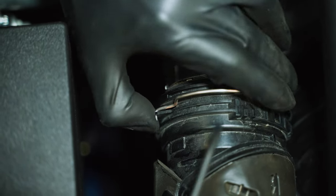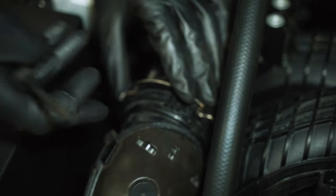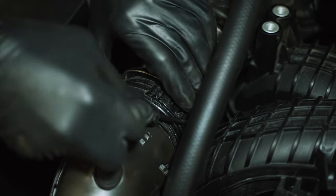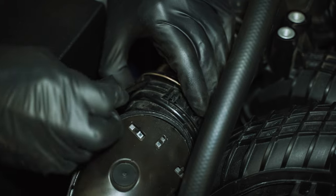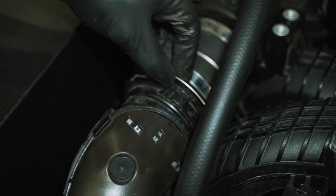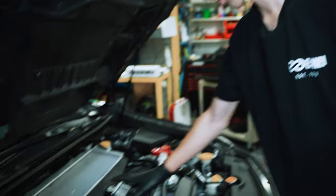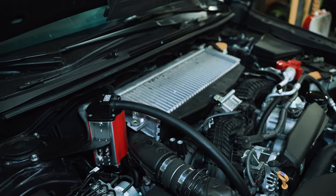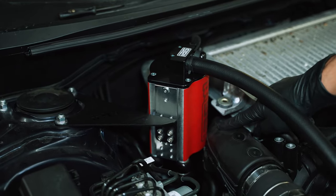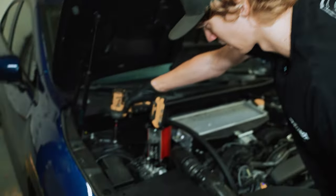You just kind of pry on there and it will pop out of the way like that. And then you just do the same thing. Like so. So with that clip removed, it should just slide pretty much that way and then up all as one piece. With the IAG AOS installed, it's a little bit tight there and you could probably get it out, but just to make it a little bit easier, we're gonna take the bracket off here.